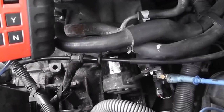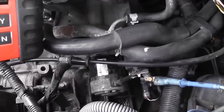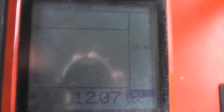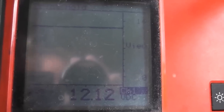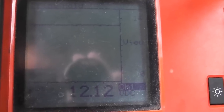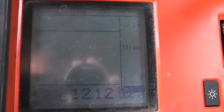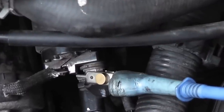This next one has a bad block ground. Doing some basic checks first — I'm using a voltmeter, going to the heavy battery post and the heavy cable, connected to battery ground for all my tests. The key is hot all the time, so you have to crank the engine over for this test to be accurate. My friend cranked the engine and nothing changed — no noise, no clicks — but he's holding it in the crank position and voltage did not change. So our problem is not on the heavy gauge circuit.